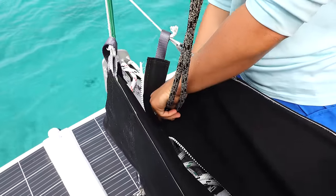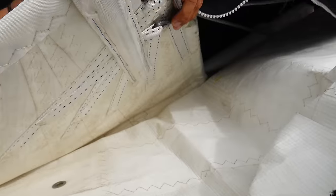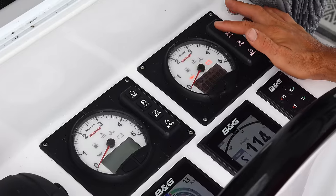We keep our main halyard at the back of the boom mainly to prevent any whacking along the mast but also to prevent chafe, so we unclip and bring her back up. Normally in a big wide open anchorage we'll sail off anchor, but the simplest way to raise the mainsail is to have the engines on and be off the anchor — that way you have maximum control to keep the boat into the wind. We run the engines anyway because our batteries are a little low; we charge them with our engines when we have a few cloudy days in a row and solar just isn't enough.